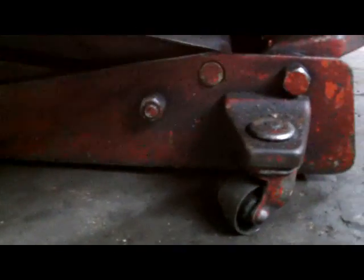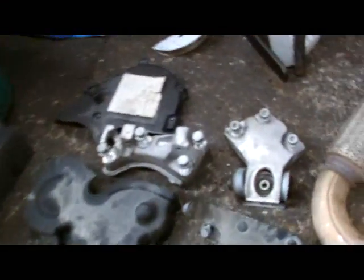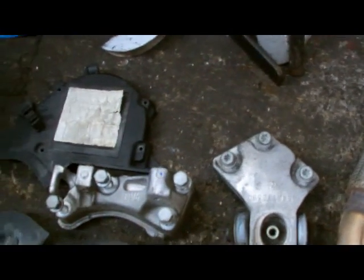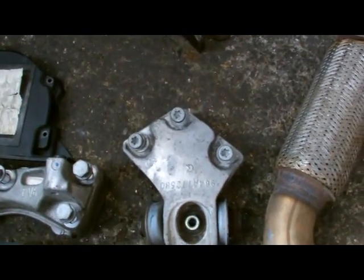To take off the belt, you take off the wheel first, then the cover, and then you jack up the engine. You jack the holder up. So once the engine's secured, just the top mount there, bracket here, top mount there, then timing covers, pulleys off, the exhaust pipe.